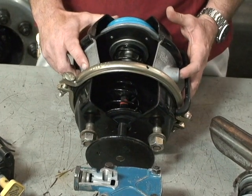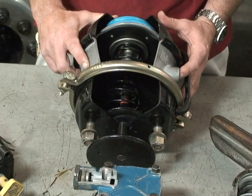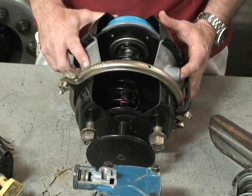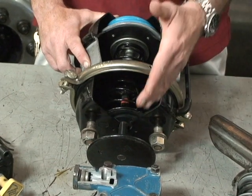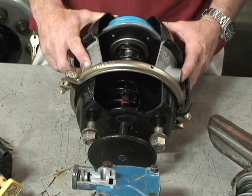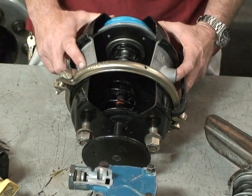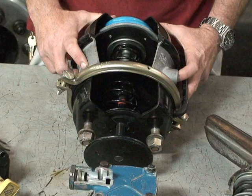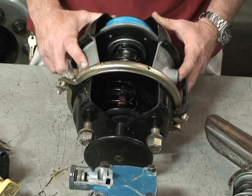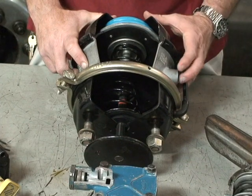That's fine. We can go up to 150 psi working pressure on our foundation brakes. Beyond that, if we get beyond 150 psi of application to the slack adjuster, we put too much force on the brake ends. They're only designed to go up to 150 psi. So we have to be very careful about that, otherwise we can create problems with damaged linings or cracked drums, twisted camshafts, damaged brake chambers, and so on.